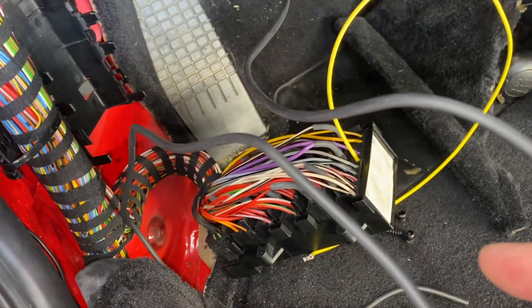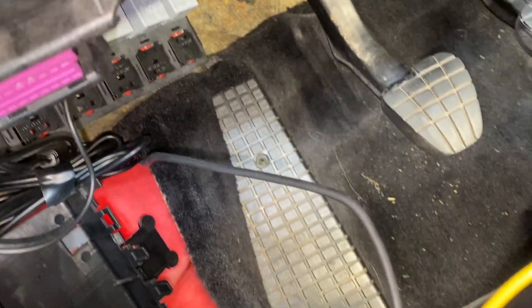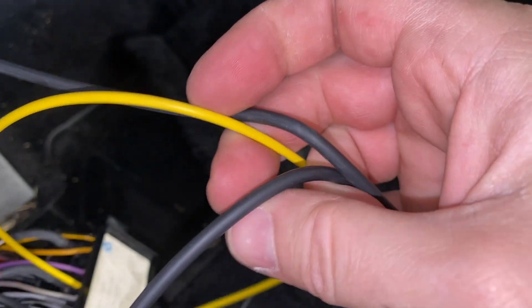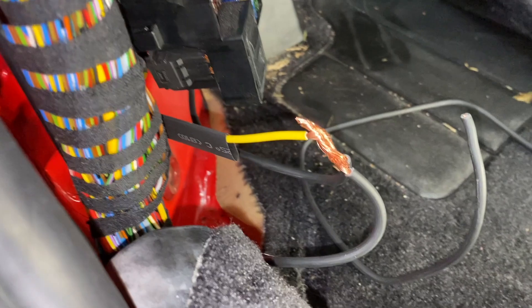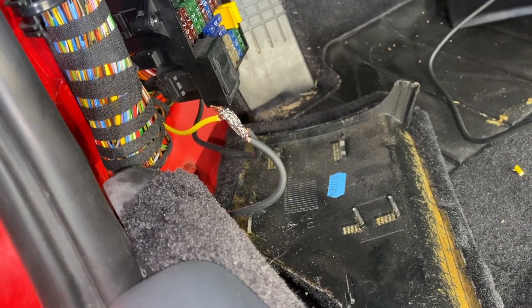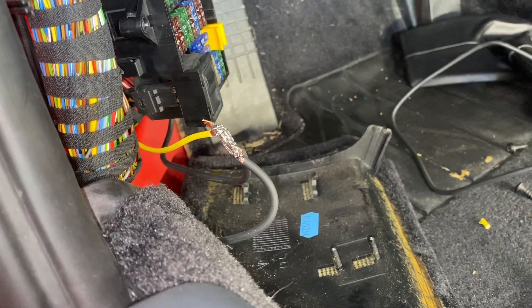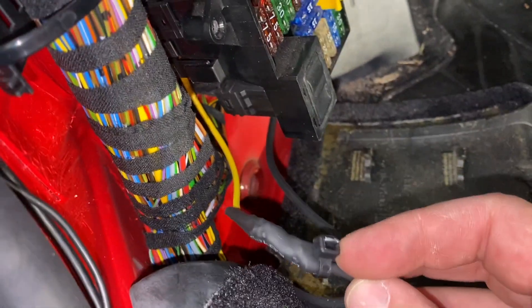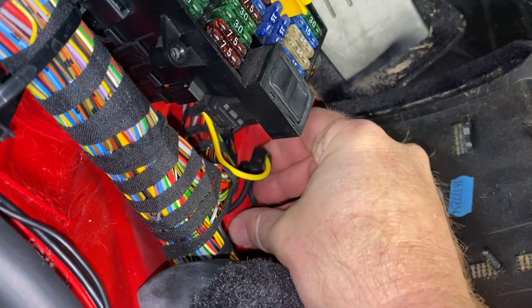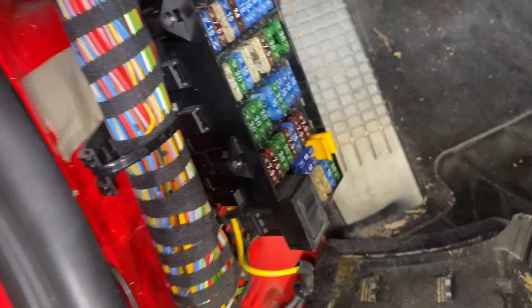I've got the power for the driver side coming out over here and the power from the passenger side coming up from under the carpet here — and this is our fuse wire. I'm just going to cut this wire in half, cut these here, and solder all three together. Here they are all three connected pre-solder — and don't forget to put a big heat shrink on there. Here are the finishing touches with some heat shrink and a zip tie on these two, then tuck them under and put the cover back on.